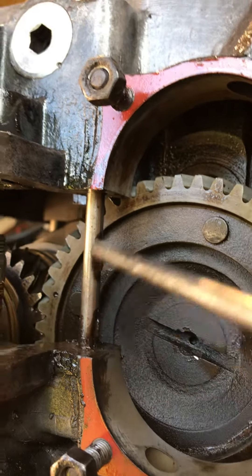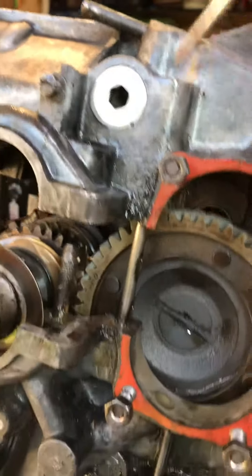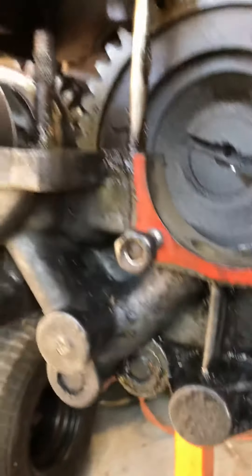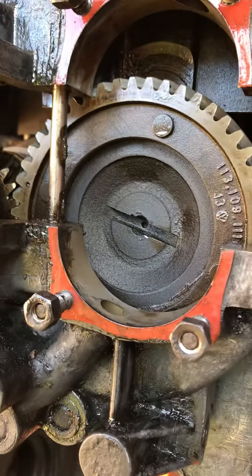So what I did — I grabbed a can of WD-40 and I sprayed every single one from the top right there, and I allowed that to sit for a while. Then I came back and I continued to hammer it until I was successful, as you can see, in splitting the engine case apart.